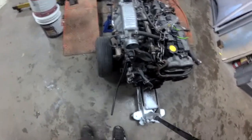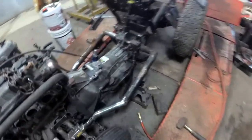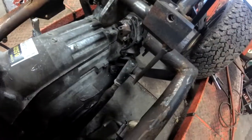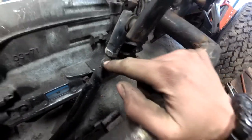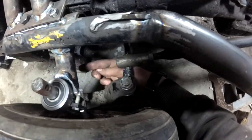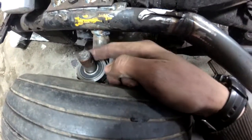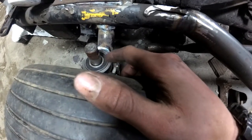I'm going to adjust it, but I have to make new tie rods. I'm not using the existing ball joints because they have a tendency to pop off — we don't want to lose steering. I'm going to use heim joints and make a new tie rod. I'm going to make the arm come off at the bottom here instead of the top because we don't have room in this frame, which kind of defeats the purpose of having the ball bearing on top.